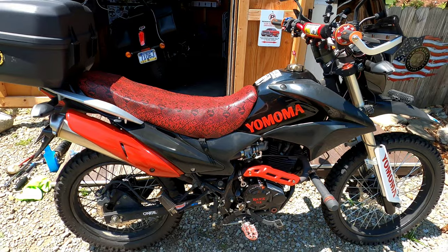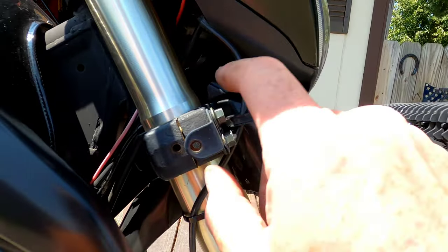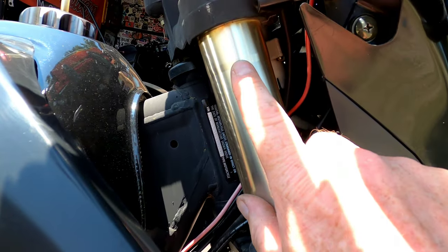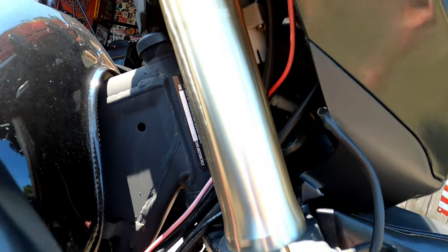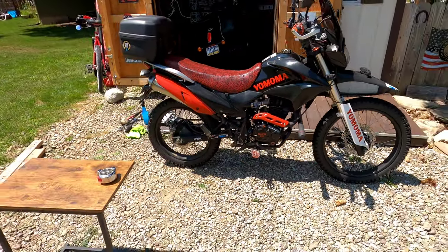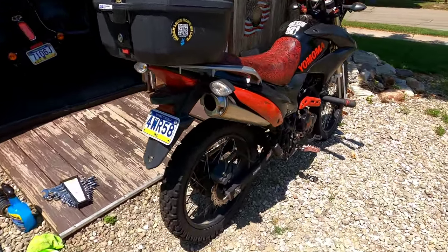I might not even bother lowering the front end, honestly. If we wanted to lower the front end, it's really an easy job — there's a bolt here to loosen up in the triple tree, same thing on the other side, and all you do is loosen up both sides and slide the front fork up. Unfortunately on the DLX it's a little fatter toward the top, so you could only drop it down maybe an inch, inch and a half. You could theoretically drop it an inch and a half in the front. But I like the geometry of the bike right now — it's more street-friendly having the back end lower and leaving the front end. I actually like the looks of it this way.